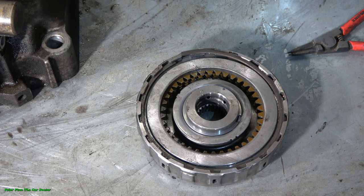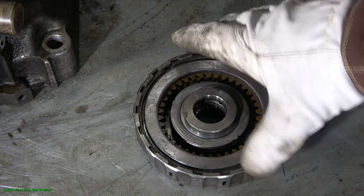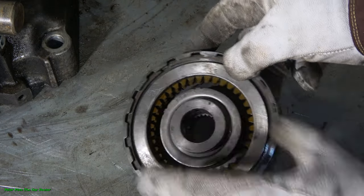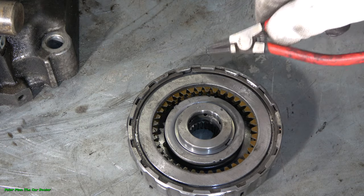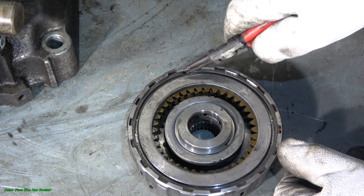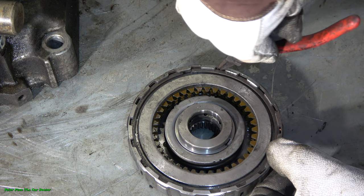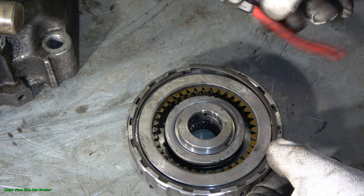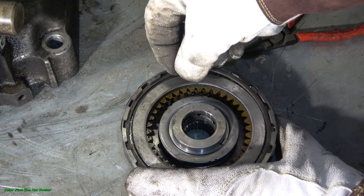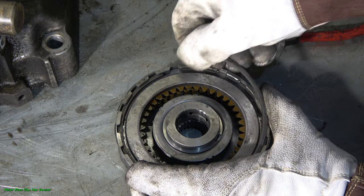And now we have a nicer view. And this is really this clutch plate locking pin. And it looks like that. And there is a small cut hole in here. And this is important that we find that. And then when we find that, we install some sharp head tool in here and bend carefully in this way. And then I need to only move that little by little, and this locking pin opens.